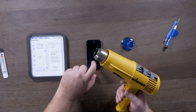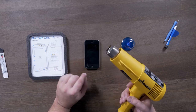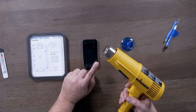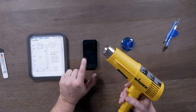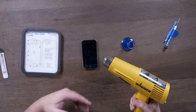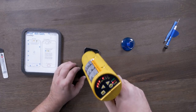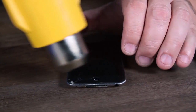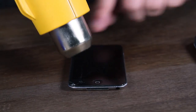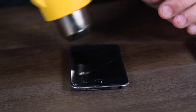I'm going to take my heat gun and heat up the glass. You don't want to heat it too long, but you don't want to heat it not enough either. If you heat it too long you're going to end up damaging the plastic bezel around the edge — as it is plastic, you could potentially melt it. We're going to heat it just enough to where our fingers feel the heat but can't rest on there. I'm going to focus mainly at the bottom edge to the left and right of the home button — that's where the most amount of adhesive is. The iPod Touch has adhesive all the way around but very thin strips up the sides, and a very small area up at the top, as most of the top is held in with a metal bracket.